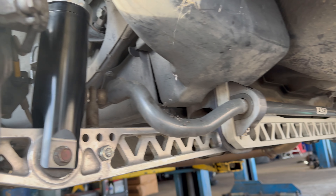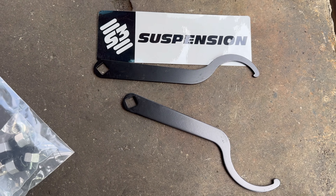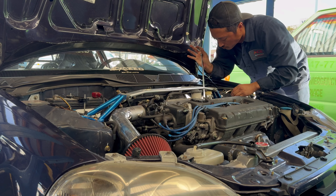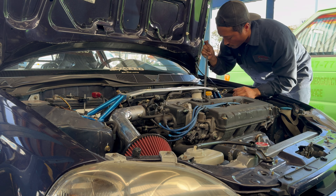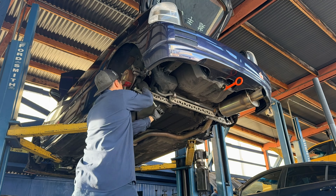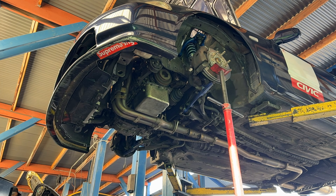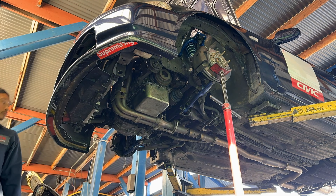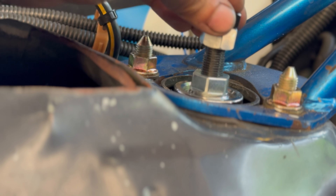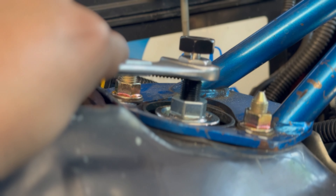Now with the suspension on the car, let's take a look at what else is in the box. A good snug on that bottom perch. New coilovers are installed and now we are tightening down the bolts loosened during the installation process. I recommend always clocking the bushings by raising the arms near static position before fully tightening everything — this can also be done with a floor jack — and the aim is to reduce any chance of the suspension binding. Damper adjustments can be made by clicking the knob either clockwise or counterclockwise. Installing the knob onto the top mounts was particularly satisfying.